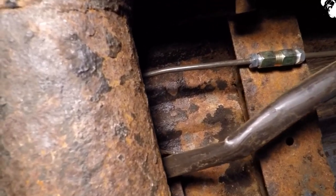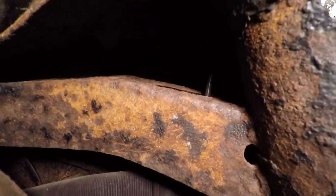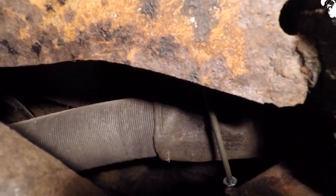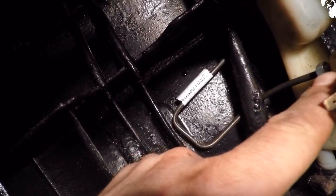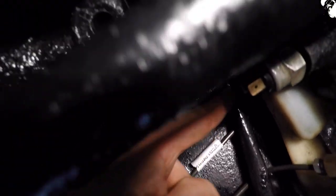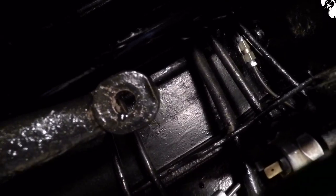The path that it takes is up over the top of that torsion arm, through that support, and into the tee piece at the rear. And there's the route I've taken with the pipe off of the master cylinder — a little bit wiggly, but trying to lose a little bit of length — and then up to the connector. Not in the best place but still accessible.